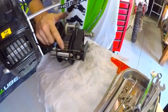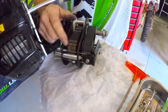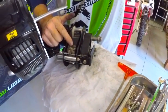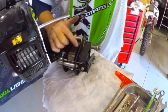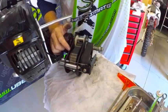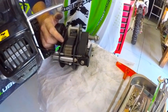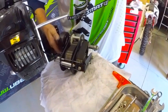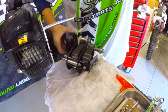Remember, cable tension is what keeps the bike in gear. If the cable tension is too loose, it will not hold second gear — it will slip into first gear, creating friction in the second gear and causing the gearbox to overheat and sustain damage. You must have firm thumb pressure; if there's no thumb pressure it won't hold second gear. In first gear it should freewheel both directions easily; in second gear it cannot go one way but can go the other.